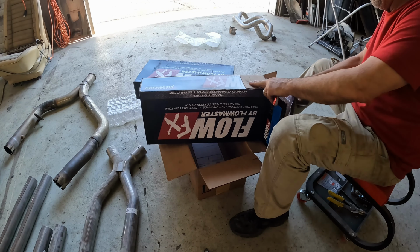And there's a couple of different ways to address that. One of the ways would be change the slip joint on the headers. My solution is going to be at this slip joint right here, which there's just an extension pipe running from the X pipe forward. So there's actually two slip joints here. I'm going to eliminate one of those. What I'm going to do is I'm going to put a V-band clamp right here on both sides. What that will allow me to do is when the time comes for the necessity to separate the exhaust system or take the exhaust system down for any reason, take the V-band clamps loose here and here, and then the rest of the exhaust system can either stay in place or be removed as necessary.